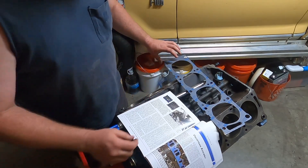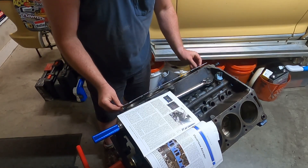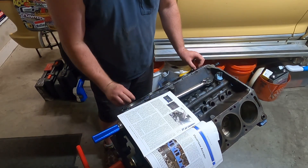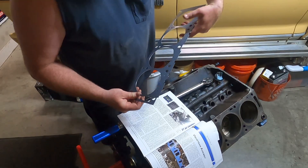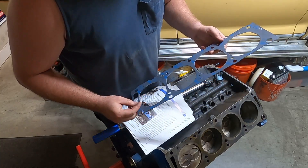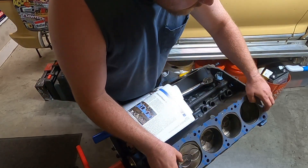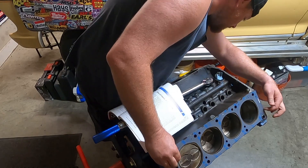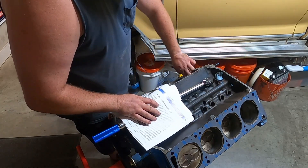That's okay if you do it, as long as it doesn't get heated up or pressurized, so everything's clean. I've got a square coming out here at the front of the motor but not at the back. Now, if you take this — so this is gray face up — and flip it over, this is a Felpro unit, part number 8554 PT. Set it in there like so. You've also got a square 90 on the front, so when you have your gasket setting in there it'll be correct.